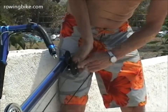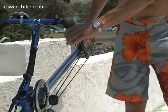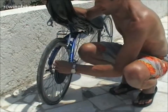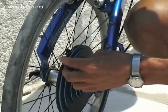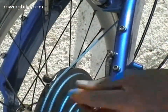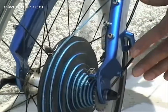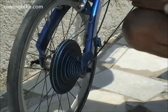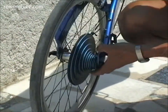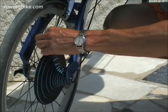Put the bike against your knee, and now you put it over the bow pulley, and there's tension on it. There is an important thing here, that the rest of the shock cord is not in the way of the cable, so it has to stand up. Well, this is a pretty much used bike. It has 4,000 kilometers on it, but that's what the bike is made for, to have a lot of mileage on it without problems. So, if the nut is over here, then it might block or push the propulsion cable off the snag. Then you have to wind it up again. So this is a point of attention.